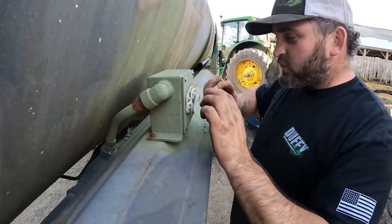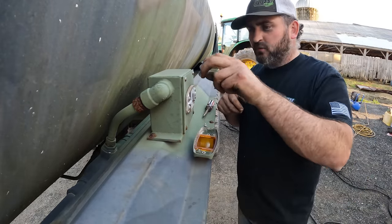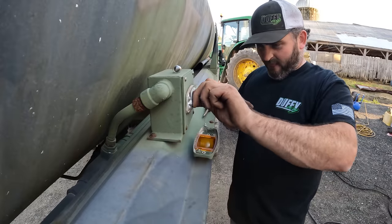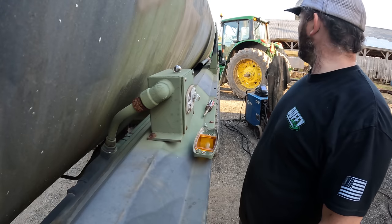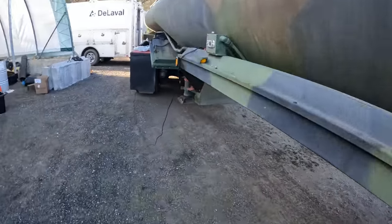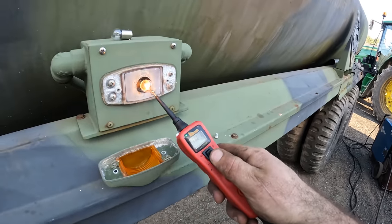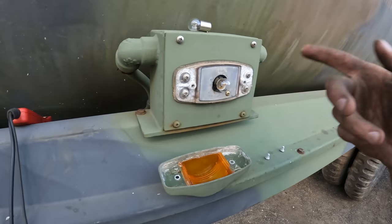This thing's got a little bit of corrosion. I'll pop this one out — it's a 623, so those are the original ones that were in it. I think that's a blinker when it comes down to it. Let's put some power to some things and see. Here's our issue: grounded — works. Not grounded — doesn't work. So that's our issue. We got to clean these up — they just got corroded and caused that issue.